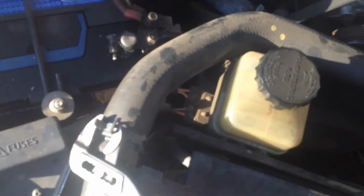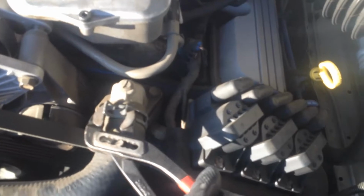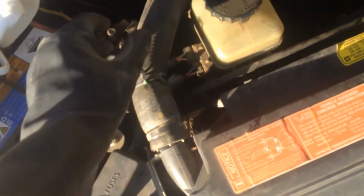Just take off that clamp. So I don't need two hands for that. Take off this other hose clamp. Just sort of need to grab it, readjust your multi grips, and re-grab it, get it right off out the way. And you should just pull straight off. A bit of manoeuvring. That one's pretty dirty. And this one here looks absolutely baked on.